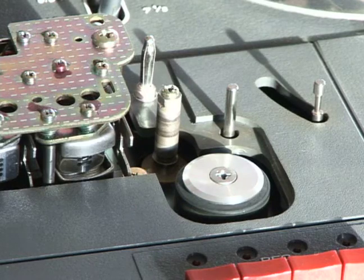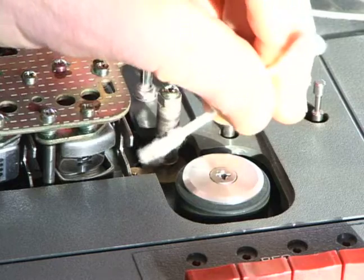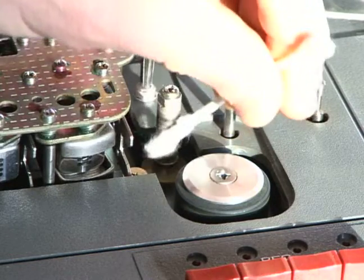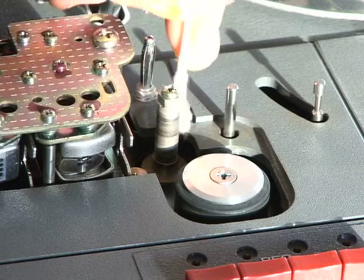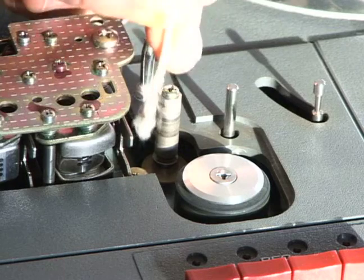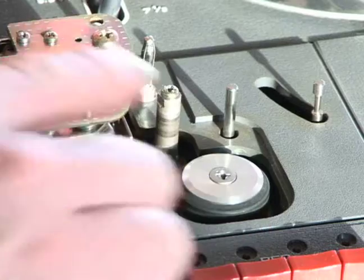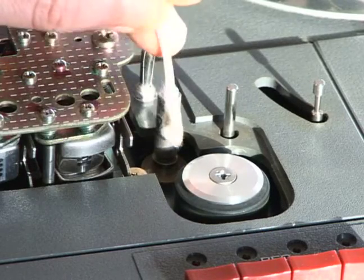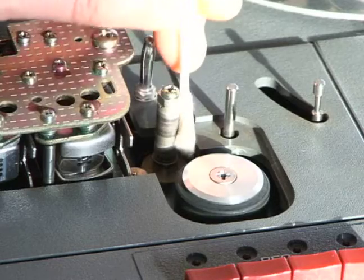Generally what I do is, after I've got a nice fresh supply on the Q-tip, I just rub it up and down as it goes around relatively quickly. You can generally do a great job of cleaning off the capstan — pretty nominal. And you can see very clearly that there is some residual that has just ingrained itself into the capstan.